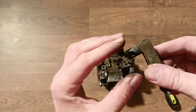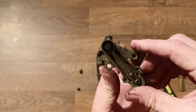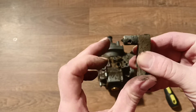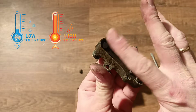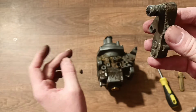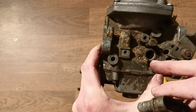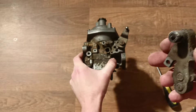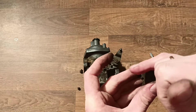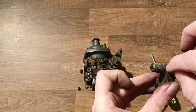How can we check it? The tapered form is like this. The temperature compensator works like this - the bi-metallic strip pulls our plug and opens it depending on temperature. It regulates all the time. Here there should be a sealed ring - I think it was at the bottom - but it should be sealed to prevent penetration of air between surfaces, because dirty air can get in here.